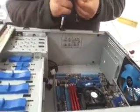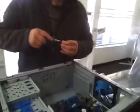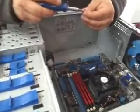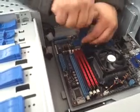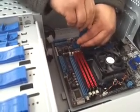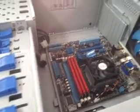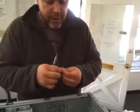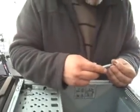And so what you should be seeing now is your computer starting to come together. And if you look down in there, it's starting to look real nice. Memory looks bright red, but I love that color. And I stress to you, you do not have to tighten these down super tight. There's no point in it. You got 8 of them, it's going to hold it. The only purpose of putting these in here is just making sure the motherboard isn't going to slide around. Other than that, there's really nothing. It's not going to ground, it's not going to do anything. You're fine.